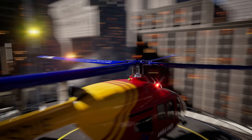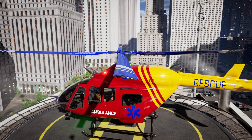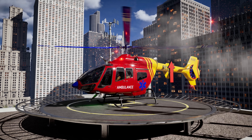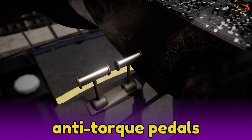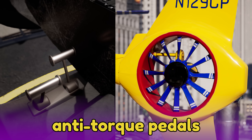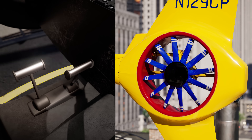See how these two rotor blades are angled down, while these two are almost flat? Now there is more lift on one end of the helicopter, so it tips over and flies in that direction. These are called the anti-torque pedals. They control the pitch of the tail rotor blades, which will spin the helicopter to the left or to the right.